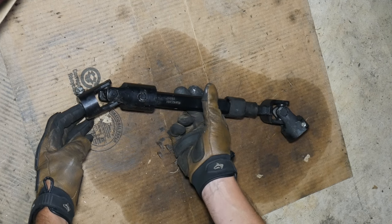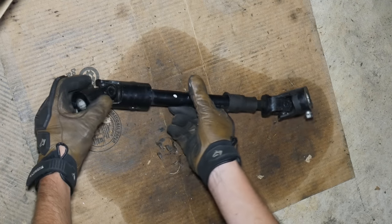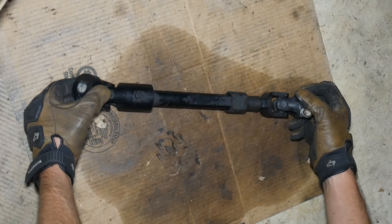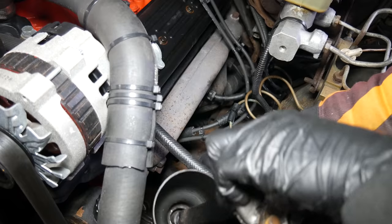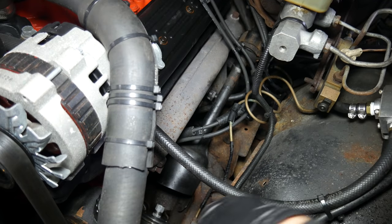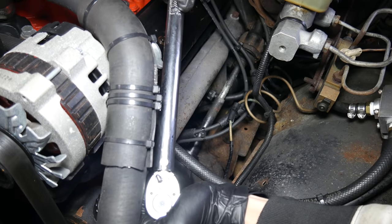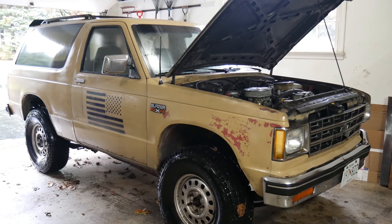there goes that plan. I suppose we could cut and weld and really do some modification to make this thing fit, but in the end, it probably wouldn't be worth all that effort, and we'd really have to put some faith in those welds. So, for now, what we're going to do is, well, reinstall the steering shaft we just removed. We slotted it back into place and hammered on it a bit to extend it again, and reinstalled and torqued the upper and lower hardware. So as far as the truck is concerned, we have done nothing at all.